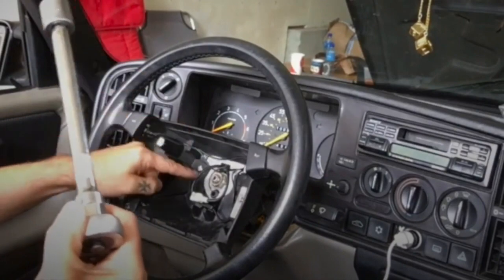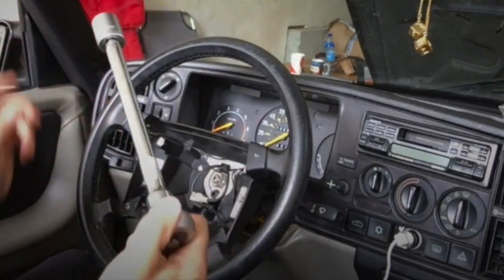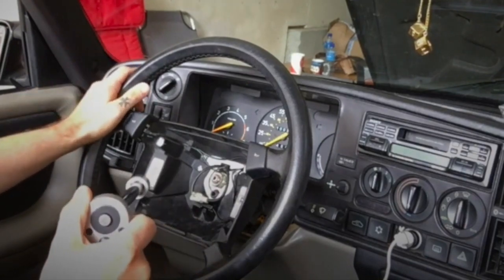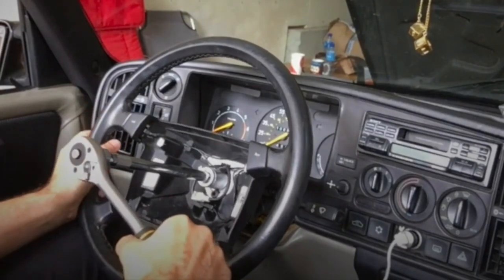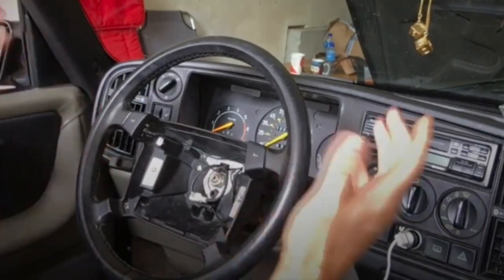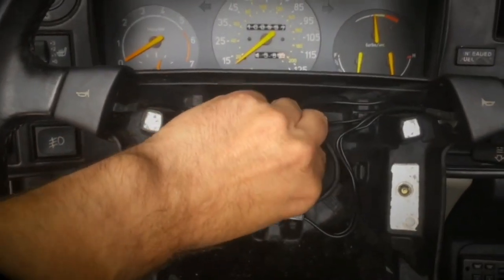We're ready to crack the steering nut now — using an extension ratchet and 22 millimetre socket. While I do this I'm keeping the steering wheel central, because you tend to turn it while loosening and I hate it when everything goes back together and the steering wheel is misaligned. I'll slightly loosen the nut and bring the steering wheel forward just a tiny bit so I can get more tape in there to stop that clock spring.